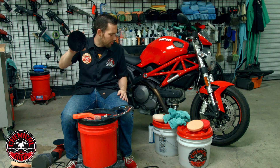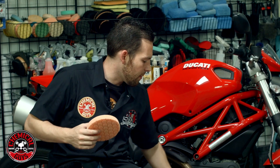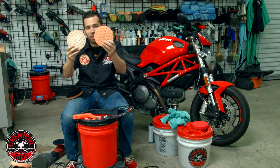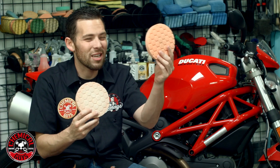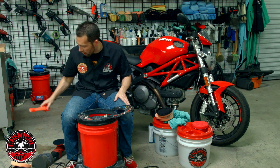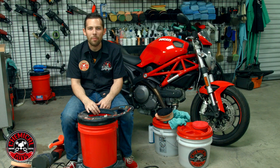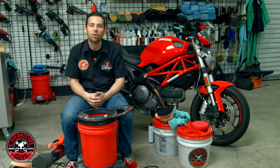Our pad is perfectly clean — perfectly clean microfiber and a perfectly clean foam pad. Just to show you the before and after: here's a dirty foam pad and here's a clean foam pad — it was able to pull out all the dirt and debris. These pads are both used pads, both polished the same amount of time, about a month old, and you can see this pad still looks brand new because it's always washed in the Universal Pad Washer. When you're done, pour out all the water from the bucket and dispose of it properly — down a sink or a drain. Your pads are all clean and ready to go — just let them dry and store them in a nice place and you'll have great polishing any time you go to do some paint correction.